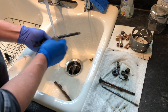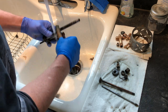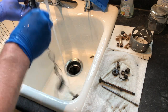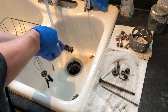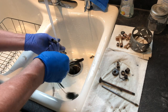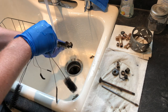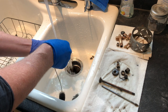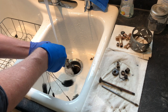Again, this is 4-aught steel wool, and it's the finest you can conventionally buy, at least in a regular hardware store. And I'm checking both of the burner screens are in good shape, so that's good. Get this as clean as we can. We can't get inside the burner tubes, but we can get at least the air tube clean.